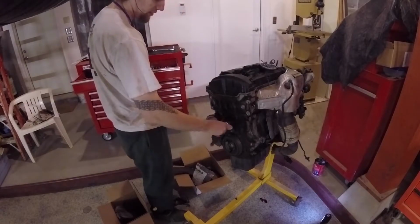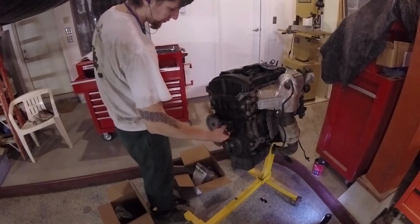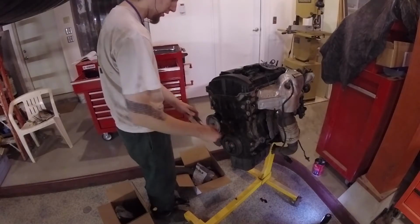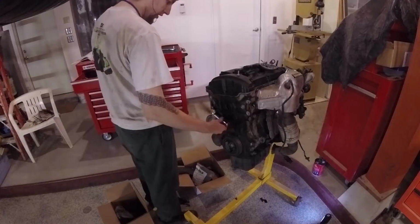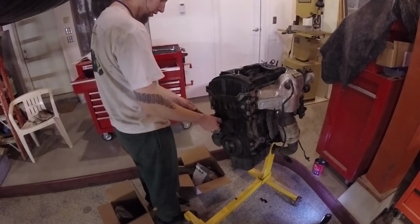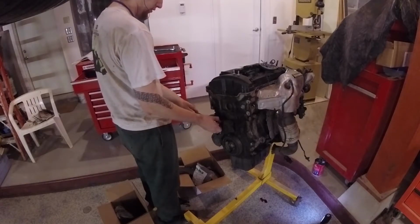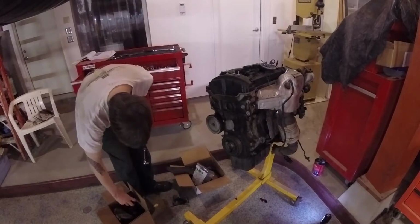I think there's 3 of them there. Just pop them out. And then the whole water pump drive wheel and tensioner for that assembly will come off. If you're this far into it, probably a good idea to replace it all. I know I did when I put this thing back together. It got new belts, new tensioners. It just made things much, much nicer in terms of less things to worry about.